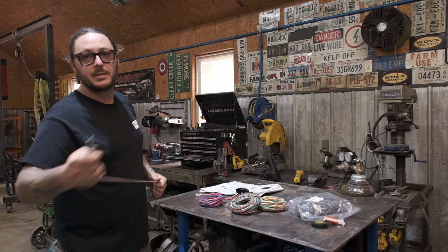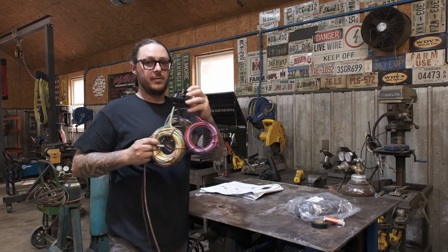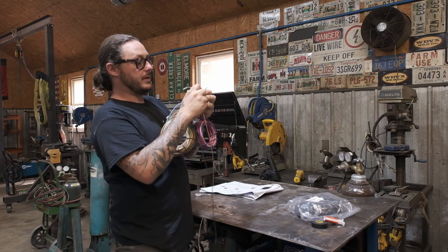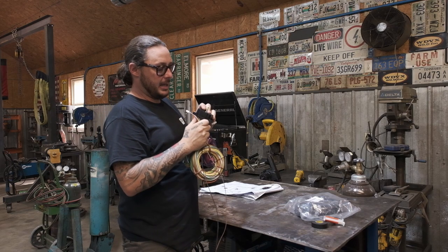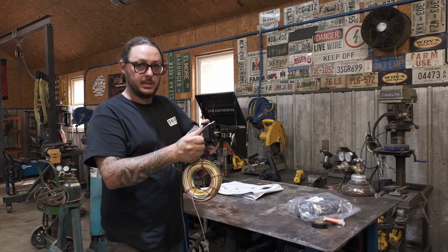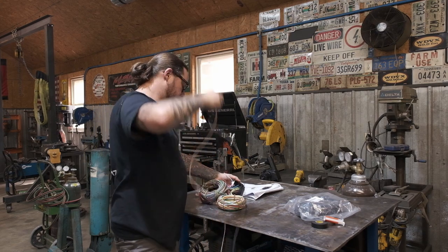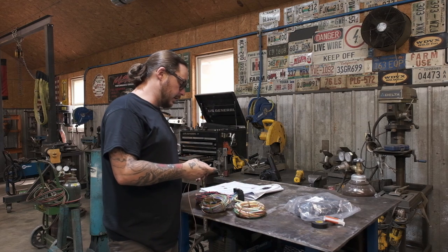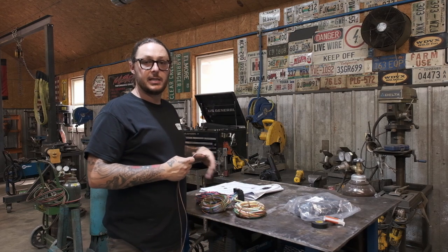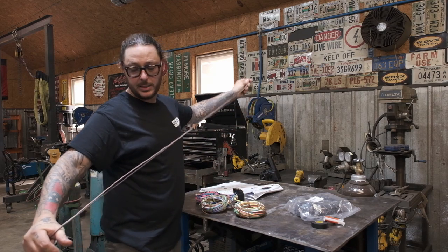So moving on with the next piece of the puzzle for the Scout wiring harness. These pieces of the harness plug-in are actually three different sections and they all snap together. I think that's going to be pretty obvious when you open the kit. These actually plug into the main fuse panel. So what they have done is they have included some other circuits and they haven't gone ahead and pinned them out because I guess they don't want to make assumptions about what you're going to actually run.